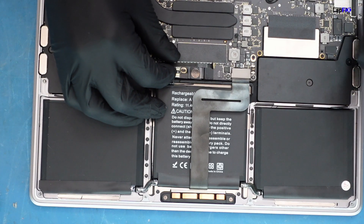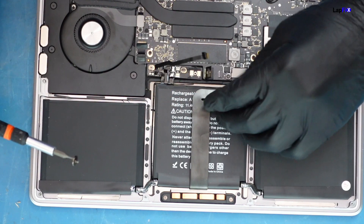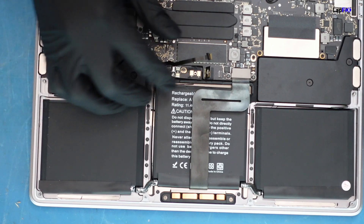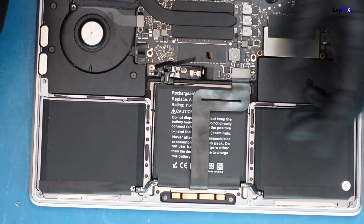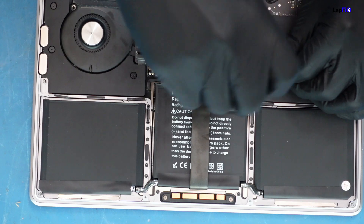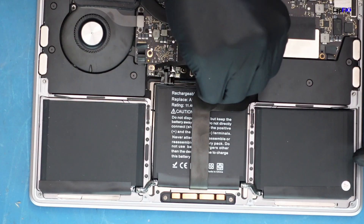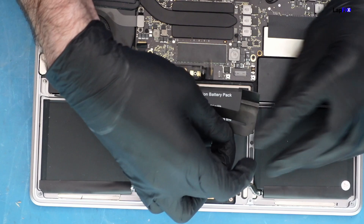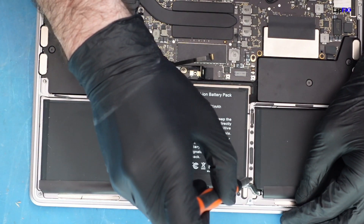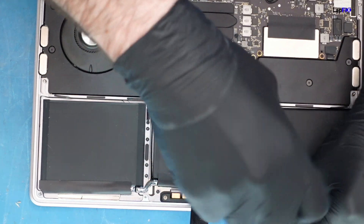I want to make sure this is the data line that goes for the battery — if you unplug it the laptop will turn off. This is also where you get the positive and negative connection for charging. We'll undo that so there's no electricity going through as we open it up. Let's remove these screws — they're not too stripped so they come off easily. We'll pop this open and see if anything is obvious. It feels like it was completely seated, so this probably isn't our problem. The issue is most likely underneath.